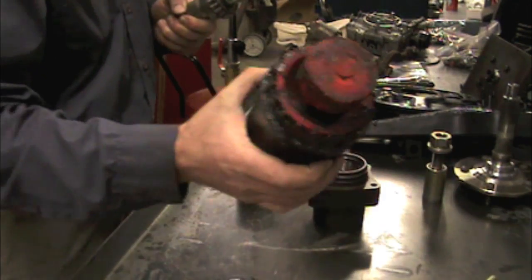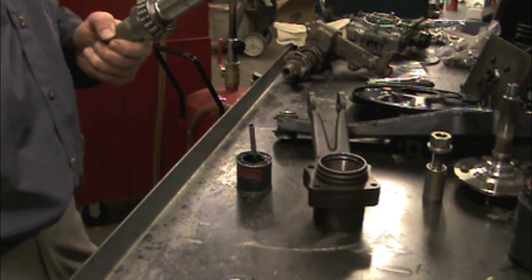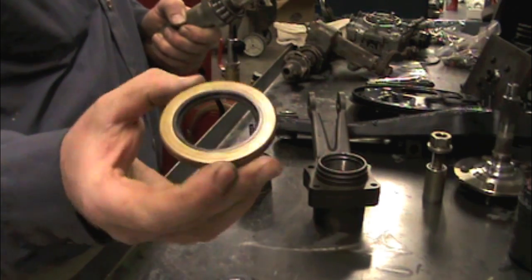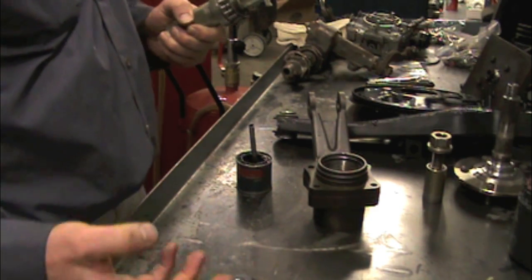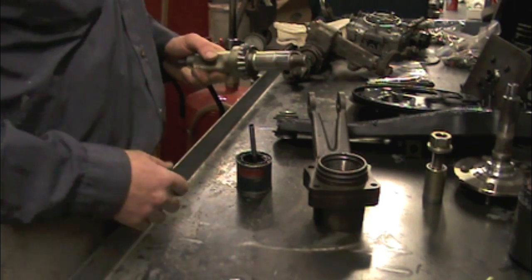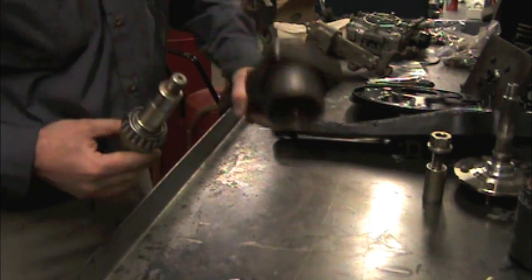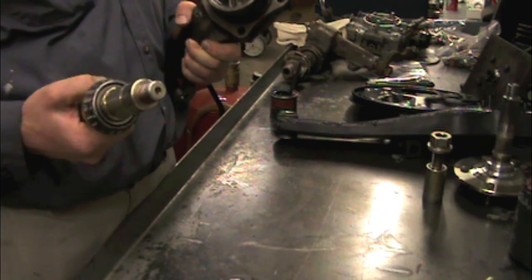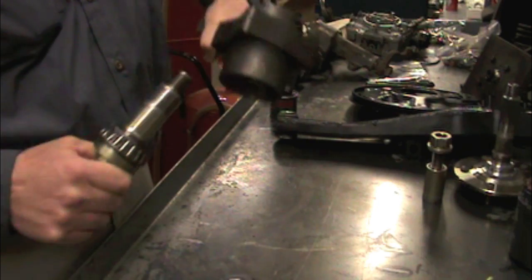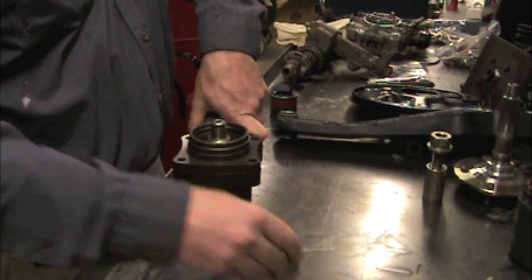Now, when you get your shims correctly and you finally pack them full of grease using a bearing packer like this, and you do your final assembly, it's going to feel probably a little bit too tight, but usually that's because you have seals that are dragging, you have yokes that are dragging, and then the bearings have to push their way through all of that grease. So for initial setup, we just want it to be with a little bit of assembly lube on the race. And so this guy goes together just like it would with the axle.